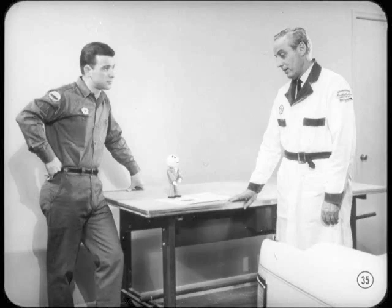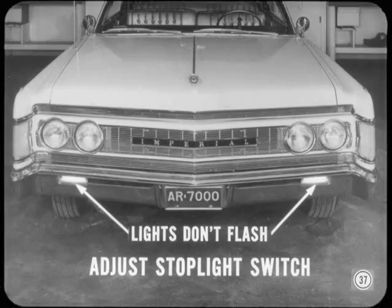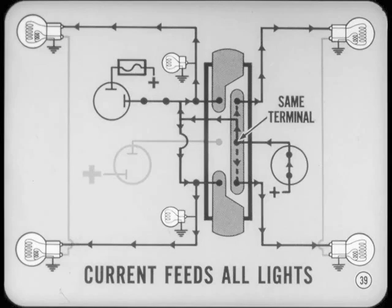There isn't much new in the way of troubleshooting, Tech, but let's take a look anyway. As we said, the hazard warning flasher will operate at the same speed even if some of the bulbs burn out, so to be sure all the bulbs are working, turn on the switch and walk around the car. If the lights come on but don't flash, there are three possibilities. First, turn off the warning light switch and see if the stoplights stay on. If they do, adjust the stoplight switch. A single filament in each bulb serves both the stoplight and turn signal circuits — if the stoplight switch is closed, the current will flow through the turn signal switch to the common filaments.